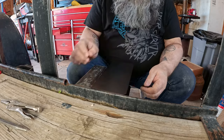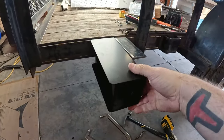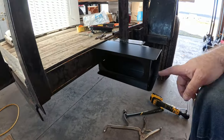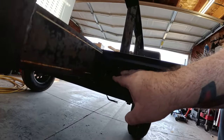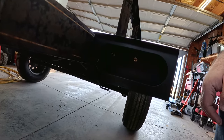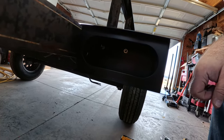All right, it's bolted up there. That is way stouter than it used to be. There's no doubt in my mind about that. And we'll get the grommets in and we'll get our lights mounted. And you'll see inside here, there's enough nut left over that I can go ahead and put a ground lug on that and throw another nut on it and get good ground continuity through the chassis.